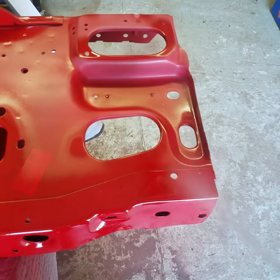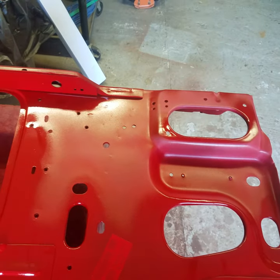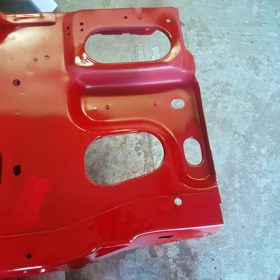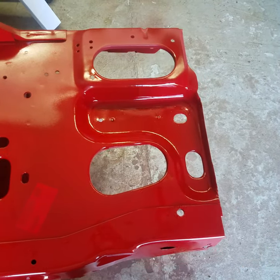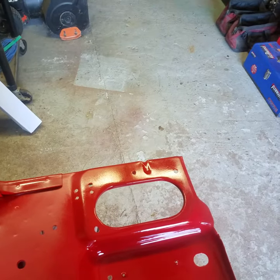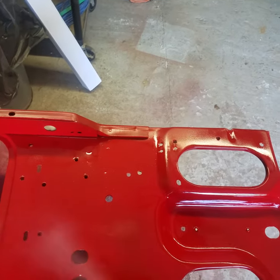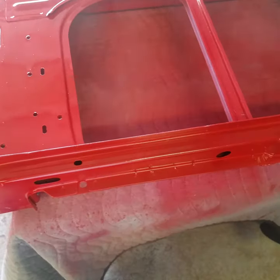Like I said, when using aerosol cans — no different than using an actual paint gun — you want to be six to eight inches away from the painted surface. I did do the color coat with a paint gun, but on this clear coat I'm not going to worry about using an actual paint gun. I'm going to do the whole truck with a paint gun, just trying to get the truck back together.